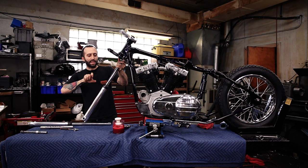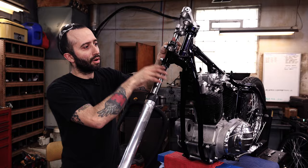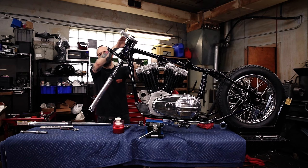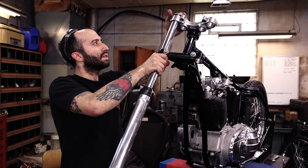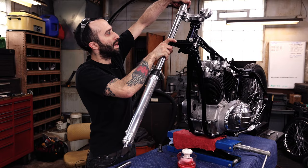And that's because somebody was twisting while they went up, and that's not the way to do it. So they should just slide straight up in there and all the way to where they hit the taper, or if it's a 39, to where it's flush at the top. And the first thing you wanna do, stick the nuts on, and we're gonna draw it into the taper first to tighten it up. You don't wanna lock your pinch bolts first. On the 35, the taper sets the depth.